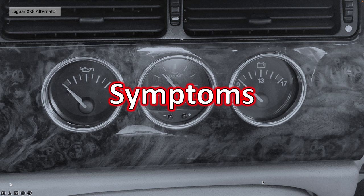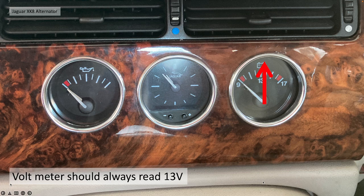So what are the typical symptoms of a failing alternator? The voltmeter — if you're lucky enough to have the three gauges in the centre above the console — should always read 13 volts when the engine's running; it should read straight up. The voltmeter isn't a true voltmeter unless the ignition is on without the engine running, but when the engine's running it just acts as a sort of failure gauge. The indicator should be straight up at 13 volts if it's charging correctly. If it flicks over to 9 or 17, it's basically a fault in the electrical system.